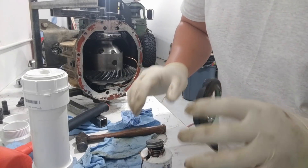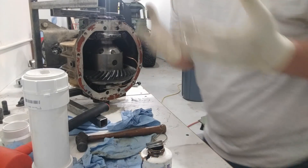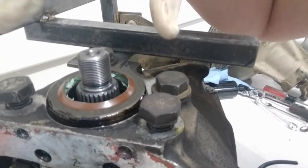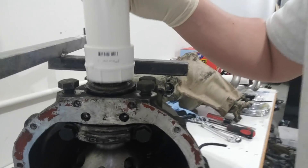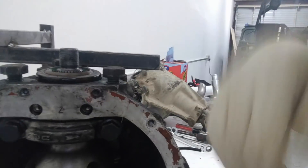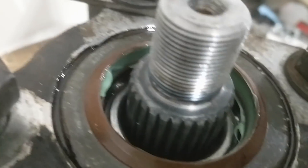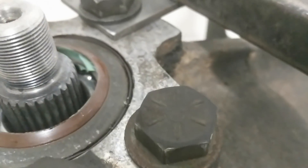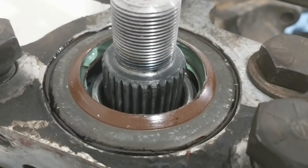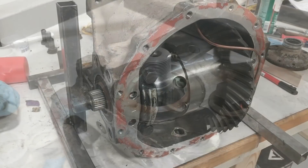I've got it all the way around — a real thin layer — and the grease is inside. Just lay it down flat on top and get it centered up so it's flat and level. Then get your eight-dollar PVC driving tool, put it on top, and smack it with a hammer — repeat until it's flush all the way down. That's it. It's flat; I put a little too much aviation sealant and it puddled up around the edges. I'll get a little brake cleaner on a rag and clean that up. Both seals are done now.